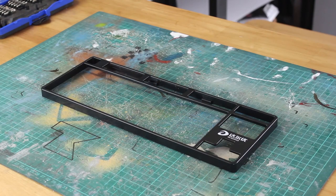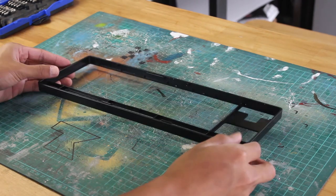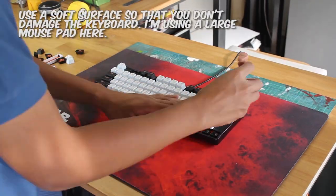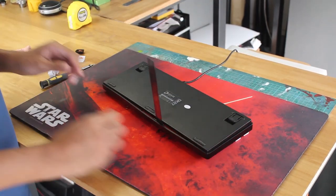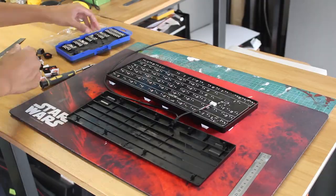Additionally, this will be mostly for mechanical keyboards that have some sort of top shell. This is the cover that covers the metal backplate that the key switch is mounted to. So the first thing to do is to disassemble the keyboard. I would highly recommend trying to find a disassembly guide for your board, but for most boards it's just having to unscrew a couple of screws and releasing some plastic tabs.